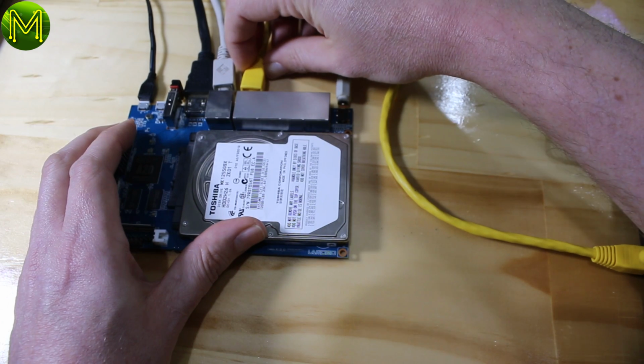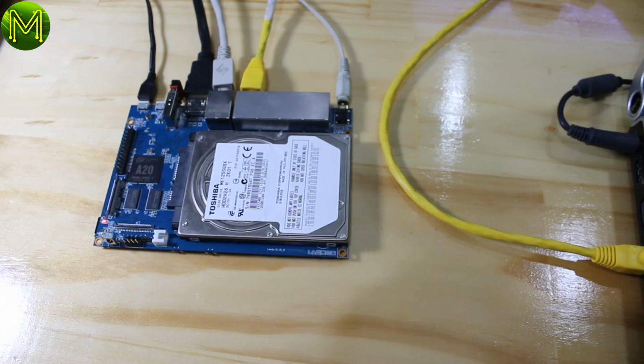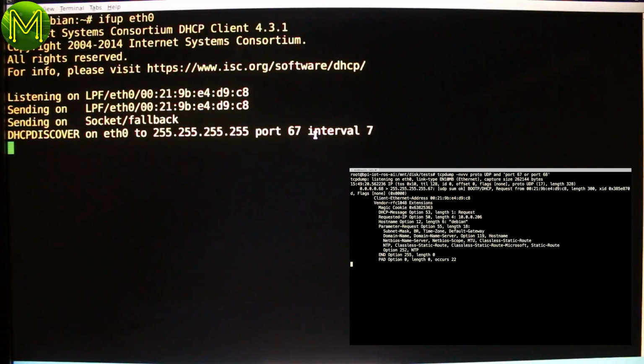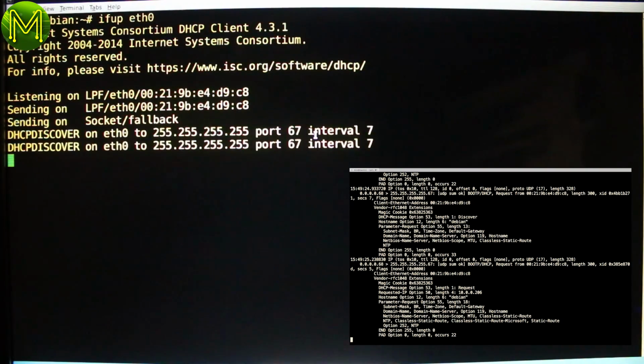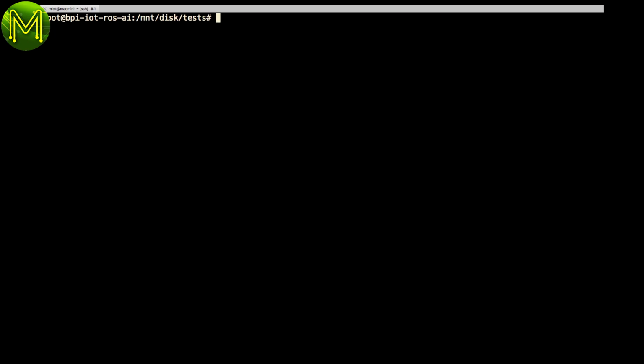If you don't configure the switch properly, you can end up with devices not being able to be seen on the upstream network. As you can see, the laptop connected to one of the ports wasn't able to obtain an IP address. If you're desperate to use anything but OpenWRT and you want to use the Banana Pi as a router, be prepared for a steep learning curve, or else just use OpenWRT.